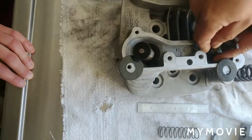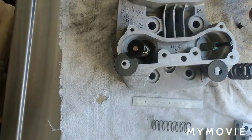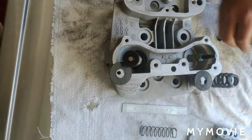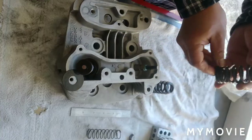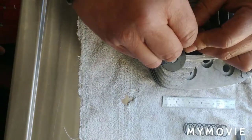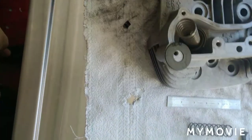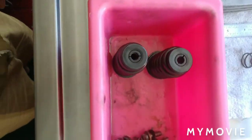Test spring out of the way. Bottom collar, keepers - this is just what I like to do to stay organized. That's the intake - you want the bucket over here? This is just the OCD in me. It's good to be OCD when you're doing stuff like this, and to record it - yeah, turn on your before-and-after, start up your engine. So that's done - that is setting coil bind.